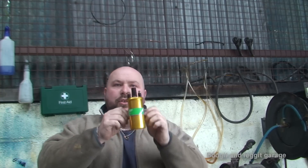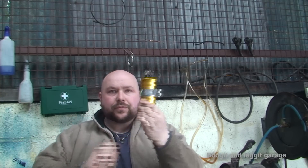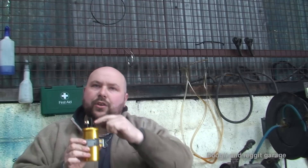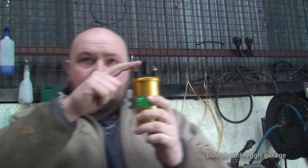The first thing we're going to put on is a modern coil. This is a coil — it just looks the same as any other coil, looks the same as the coil that's in there. The coil that's actually in there has got a pre-resistor, so the power goes through the resistor before it comes back into the coil. The problem with the pre-resistor is if it's at all dodgy, the power goes into it but doesn't come out properly. So we're taking out the pre-resistor — it's 30-year-old technology, we don't need it — and replacing it with this coil which is a lot stronger, puts more volts through, and it's new.